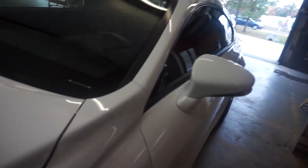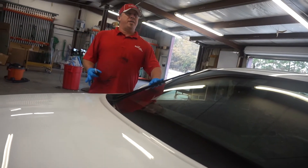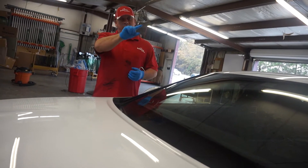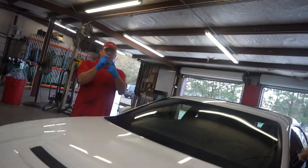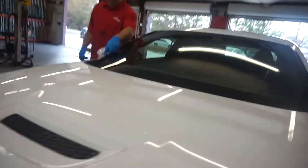Alright, let me show you. Yep, it's a big boo-boo. You gotta order the side moldings too. They glue your side moldings down — that's terrible. So if you break the glass, it's gone. You can't even pull the side moldings off the side of the window. They're not really tricky to get off but you gotta be careful, because at the bottom of these moldings they form almost like a little loop, and on the body there are two white pins with a little nipple that goes through that loop — that's what locks it in place.